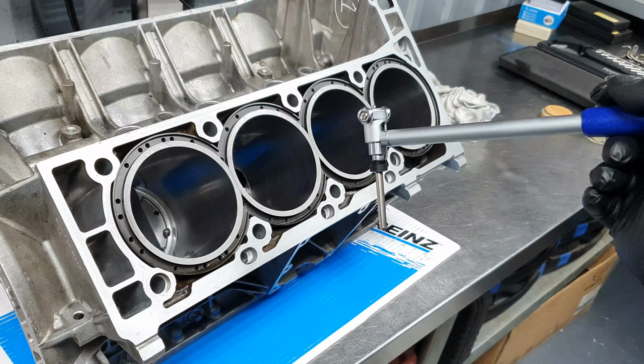Maybe the timing chain is stretched and you want to give the engine one shot to last a little bit longer. You change, let us say, the timing chain. You have to change the fuel injectors, obviously. You cannot trust them at 300,000 kilometers. Ignition coils, most probably. High pressure pumps, maybe. Bearings. And then you still have the run out in the cylinders. That's why I'm saying all the time, balance it.